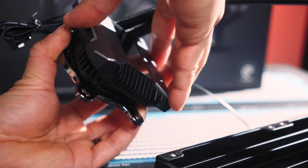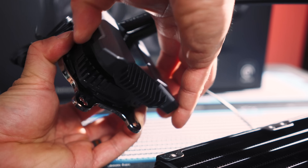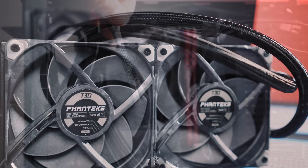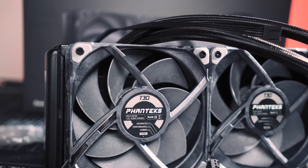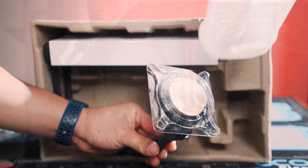That clicky noise is definitely audible even above the fan noise, and I'm highlighting it because it would bother me. In my experience, the X53's Gen 7 pump does get a little bit audible above 65% or so, but it's nowhere near as noticeable as what you've just heard. Perhaps the X53 is a little bit better dampened with its big RGB display, and the little cover on the Glacier 240 doesn't help as much — though I don't actually think that's the case, because I've heard a defective X52 and that was very audible even with a similar shroud design. My preference with this type of setup is to hook the pump and fans up to separate headers so I can have more granular control of the pump on its own.